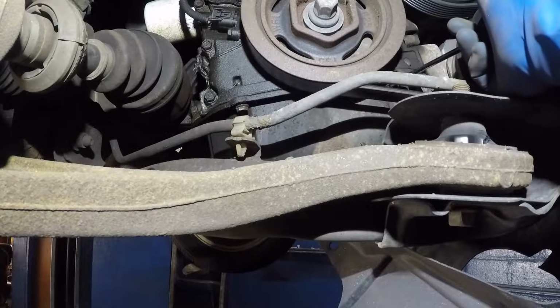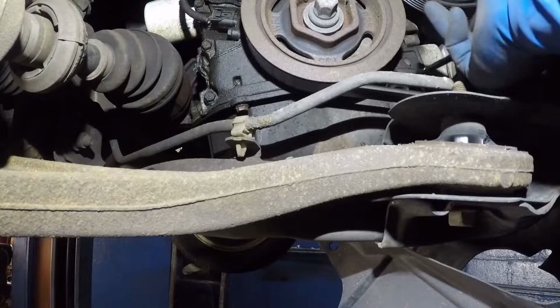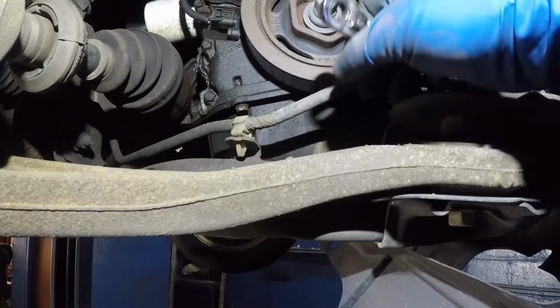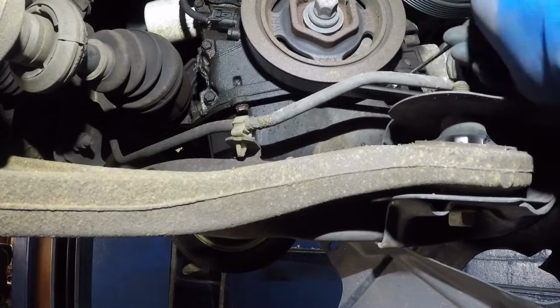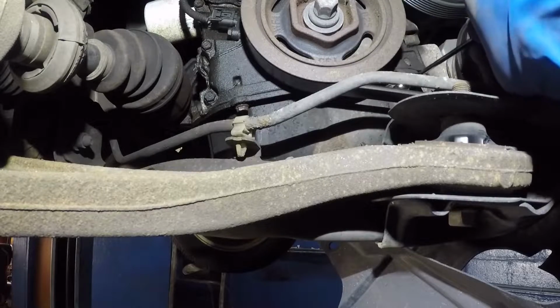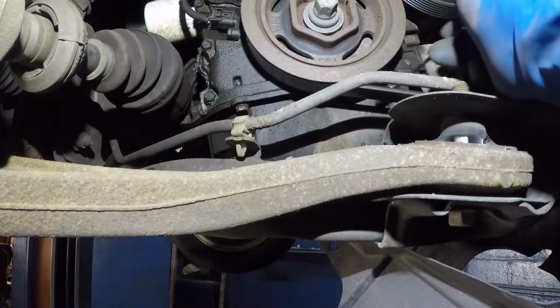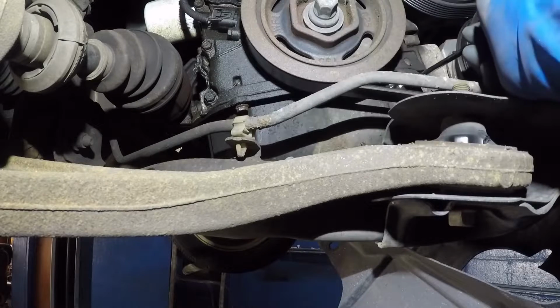When you put these bolts in, make sure you catch the threads very good, alright? I had one guy years back, he stripped the bolt, he never said anything, and the oil pan gasket leaked a little bit. And we had to redo the job and fix the threads. And this is a tight spot, you know.